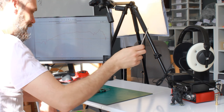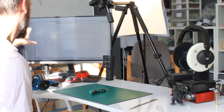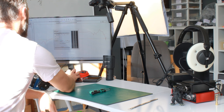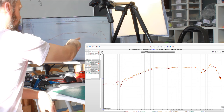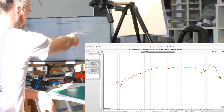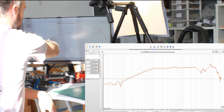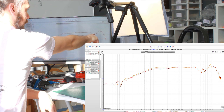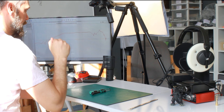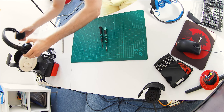That's all fitted and back on the rig — let's do the nerdy thing. Here is the graph before the damping kit was added. Now here's the second measurement after fitting: as you can see it's just a little bit flatter across the middle — it doesn't have the small hump, doesn't slowly drop off. You basically get a flat response down to about 100Hz, you pick up a little bit more in the sub-bass region, and the peaks at the top are slightly smoothed off — losing a couple of decibels there.